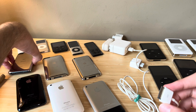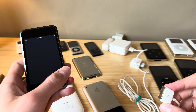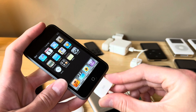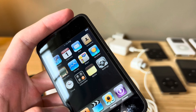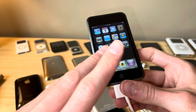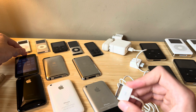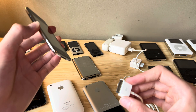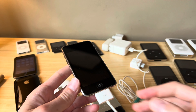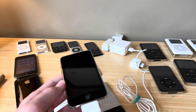Next up, we're going to test out the iPod touches. Here is a first gen iPod touch. Go ahead and give that a little swipe to unlock and we'll connect it to Firewire - and it charges, as you can see right there. This one's running iOS one, but iOS version does not matter - they all charge with Firewire. Here is a second gen iPod touch. This should not work - second gen iPod touches do not work with Firewire, they require USB.